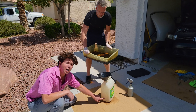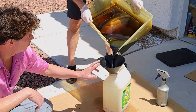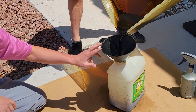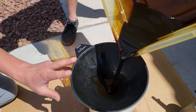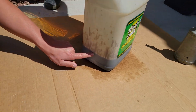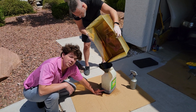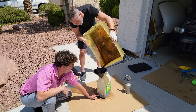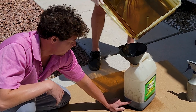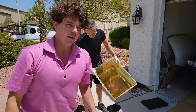We're emptying out the old oil — let's see what we got coming out. Trust the process. Here is exactly two quarts of crankcase motor oil. My deductions, with a little bit in the filter and the engine flush that we put in at 16 ounces, he had exactly 1.87 quarts of oil in this motor. It's a 3.7 quart crankcase — he burned half the oil, and that can happen very easily out here in the desert with the high heat.